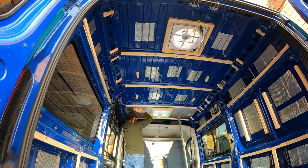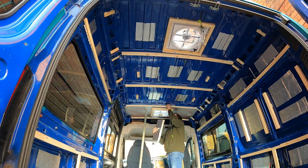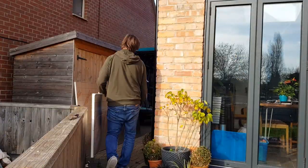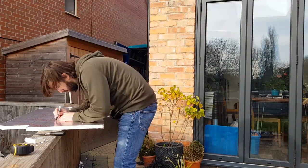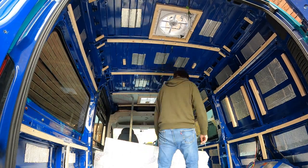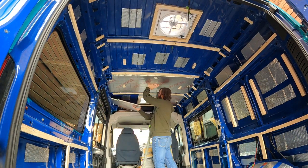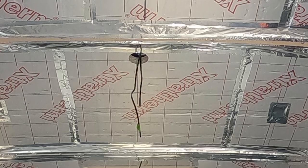One of the first things I realised was that a few little blobs on the ceiling are not going to get the job done — you really need to put a good bead on there for the board to attach. Doing that negates the need to prop them up with wood while the adhesive dries. I also learned that filling ceiling cavities with large one-piece stretches of foam was only making life difficult; the boards aren't flexible enough to follow the contour. The best approach was to put the board up in smaller pieces for a nice flush fit, and any extra gaps can be covered over with foil tape later.